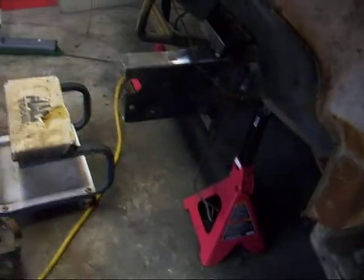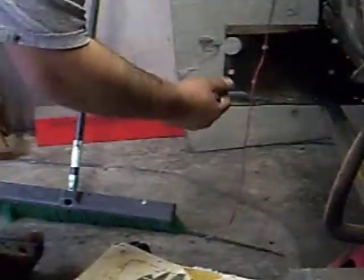So, and also, what I need to do here, the A-arm mount will interfere. I've got a small garage here. The A-arm mount will interfere right here, so go back 1 inch, and then we're going to go about 30 degrees and cut, and so it won't interfere with the A-arm mount. And I'll see you when I'm done.